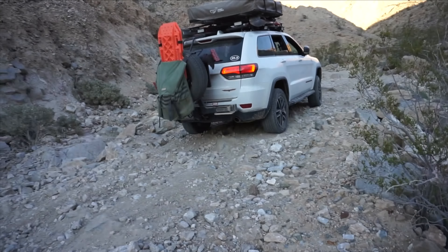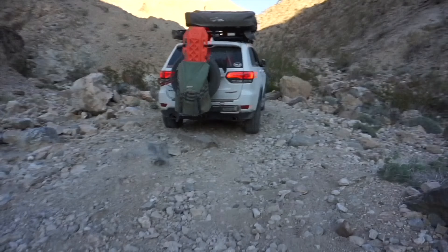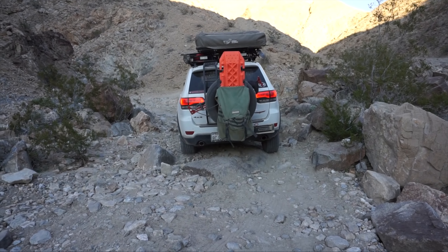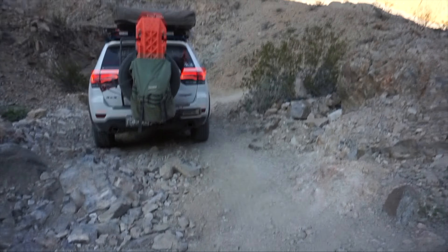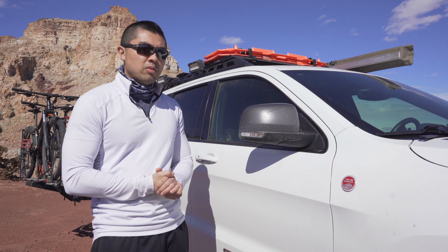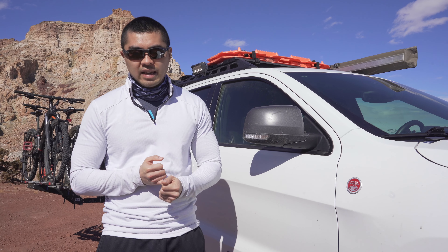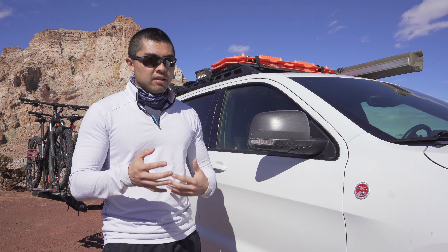There are a few pros and cons to the Gobi rack if you're deciding between the two. It does have light mounts so you can mount lights front and rear. The rack comes as one singular piece — maybe that's a pro and a con. The pros are that it's very solid; everything's welded together and made to custom order. The downside is it comes in a very large box. The Gobi rack is made of steel, with a static load rating of about 600 pounds and dynamic of about 300 — so similar dynamic range to the Chief.